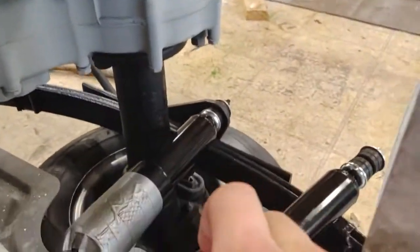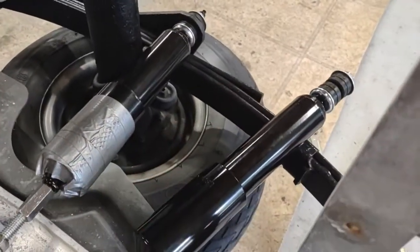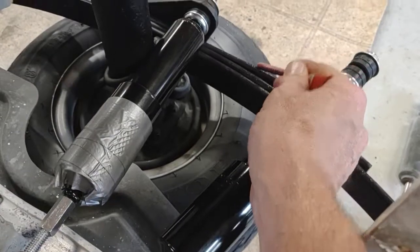So I'm putting on the heavy duty leaf springs here. This is the dual action, so it's not the stiffest but you get an extra spring all the time. And then if you get enough load, this one will stop excessive travel.